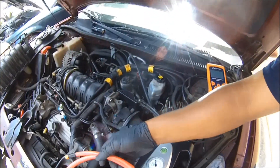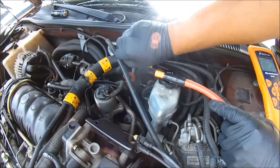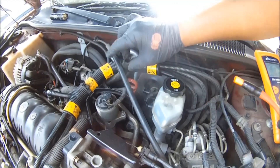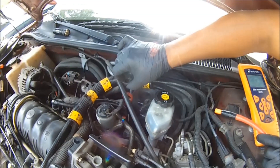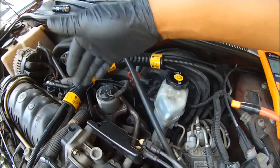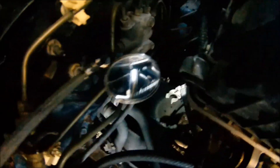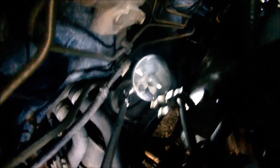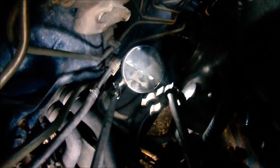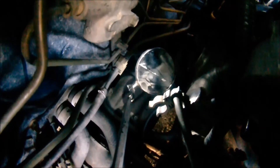When you hook this up — this is the end coming from your homemade deal — hook this up to your vacuum brake booster hose. Why this? Because this is the biggest hose available to force air into the intake manifold. So use the brake booster hose. Right there is our vacuum leak — right there. We got a hose leaking right there. Cracked vacuum hose from the bottom of the intake manifold, underneath the throttle plate. That's a manifold vacuum right there.